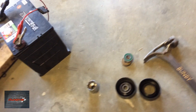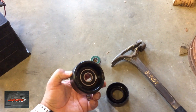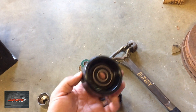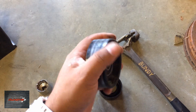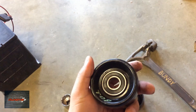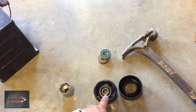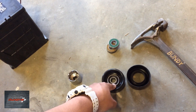There you go guys, that's how you can save some money on expensive tensioners. Like I said, the spring inside doesn't go bad — usually it's the bearings that fail, so why not just replace the bearings? I'll get a steel wool brush and get all this junk off of it as well, put a new belt on. You can save money by not replacing the tensioner, just replacing the bearings. Alright guys, have a good one and Happy New Year's — 2020, crazy — take care!